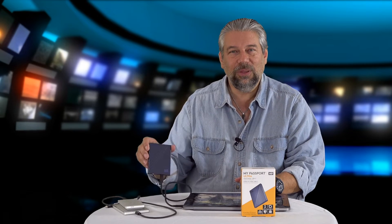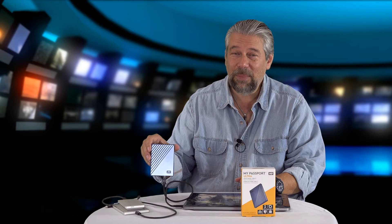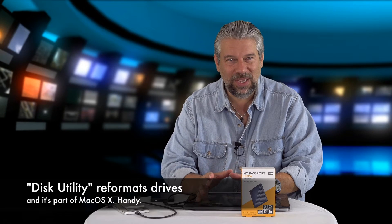The default format for this particular unit — this is not the Mac version, just the generic version — is NTFS, the NT file system, which isn't actually supported natively on the Mac. When you plug this into your Mac, you get a read-only drive and the option to install a new device driver for full support. I decided I just wanted an external drive, so I reformatted it as ExFAT, which both Mac and Windows support natively. I lost the Discovery software, but que sera sera.